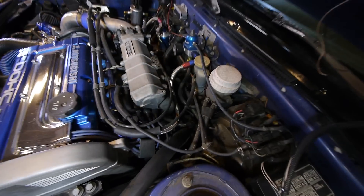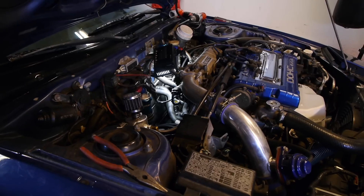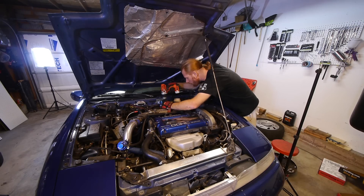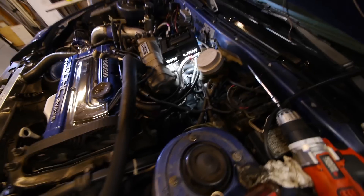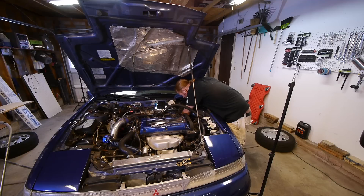The first thing we need to do is disconnect the rack from the steering column. There are three things to disconnect and they're a bit of a pain to get to — they're on the firewall on the driver's side near the bottom. Here's a picture from Laser Speed Demon that clearly shows the three things we have to disconnect. If you've got small hands and arms you may be able to reach through all the clutter, but I had to loosen up the brake fluid reservoir, move a couple of vacuum lines, disconnect the brake booster line, disconnect the spark plugs, and a few other small pieces. I also disconnected my upper AC line, but if you do this, make sure to take the car to a service station to get the AC drained first. My AC hasn't been working in a long time, so I didn't have to worry about it. Once all that was done, I could finally get a hand in to start loosening up all the bolts.